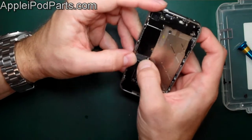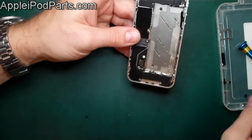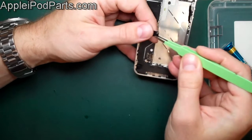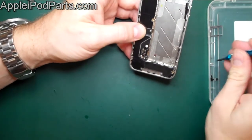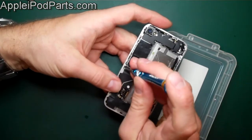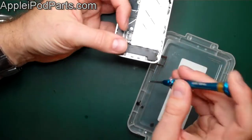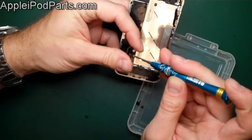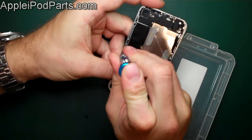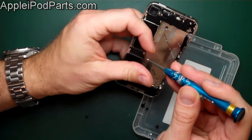For the dock connector: don't stick it down until you've got the connector on. Put the connector on first, find its home with a nice little click, then press from top to bottom down the cable. It has a little retention bracket to stop it pinging off. This will only go one way. There are two different size screws: a tiny beveled screw that sits on the outside, and a bigger screw that goes inboard. Put them in loosely first, then nip them both up. Give a firm press to make sure everything is seated.